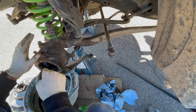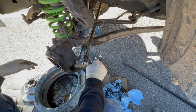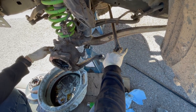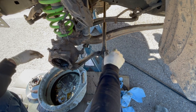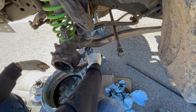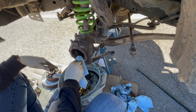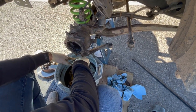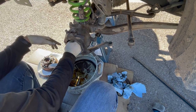I think I'm going to take this off and do the tension gauge measurement because this preload is already way too tight. It's only supposed to be around 12 pounds of force. I have a fish scale I'm going to use to measure it — it's essentially the same thing as a spring tension gauge. I'm going to start scooping this grease out because all of this will be replaced. This lower arm — I've got some Loctite for these because I know they were loose. They were actually finger tight when I first got this vehicle.